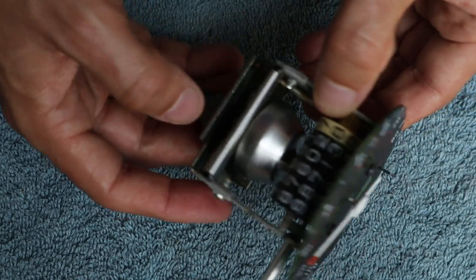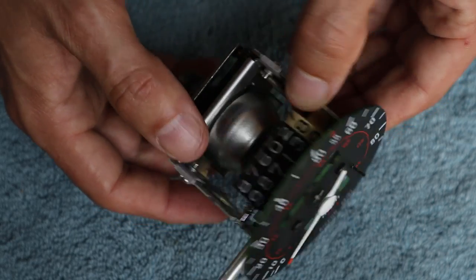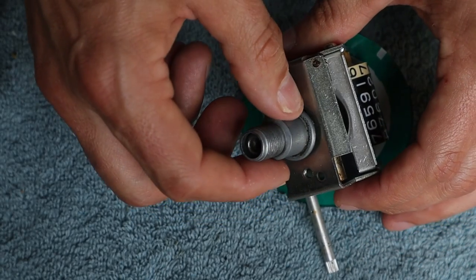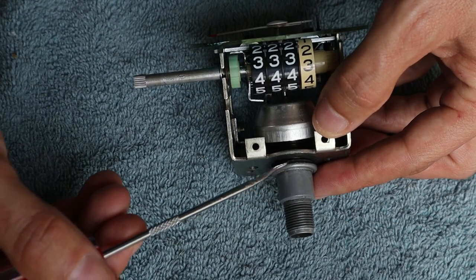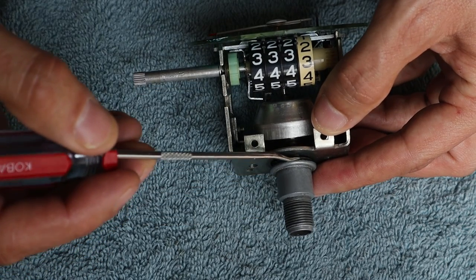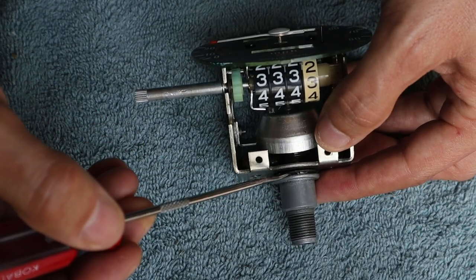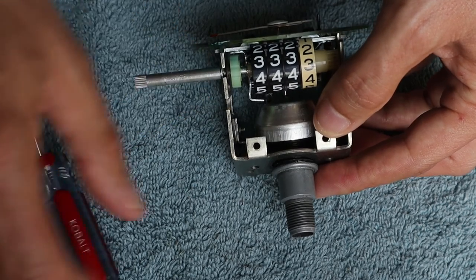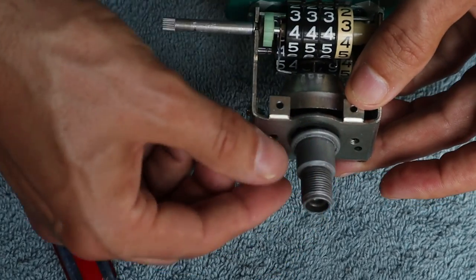With it all the way out like this, it drags on the magnet and kind of sticks and stays. I think there was a piece that was swaged or press fit on the end of this housing that kept it locked into the plate, and over time that piece has failed or worked its way out so it's no longer held securely.